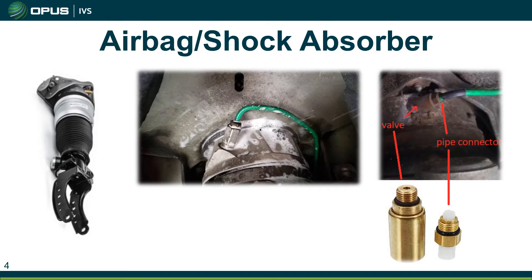One of the things that can go wrong with the airbag is that it can leak. In the center picture, someone is using soapy water to try and find a leak. The most common place to leak is towards the bottom of the bag. Over to the right we have the valve — there's a valve just before the air goes into the bag, and its job is to maintain at least 3.5 bar of pressure so if the pipe splits you won't lose all of the air out of that airbag. We can use that to our advantage when diagnosing the system.